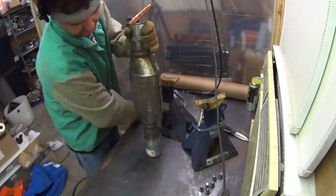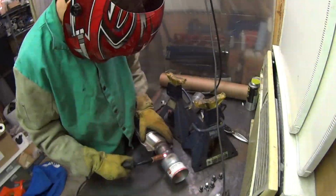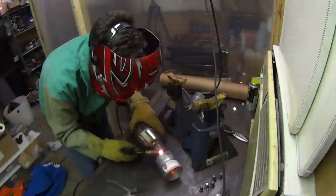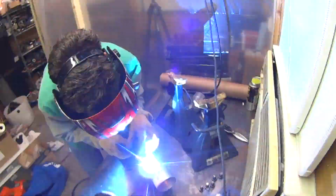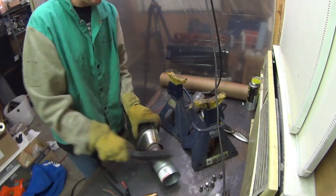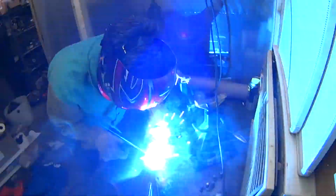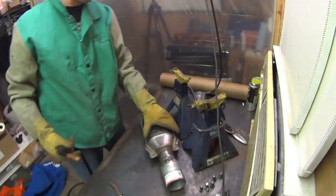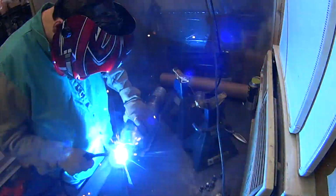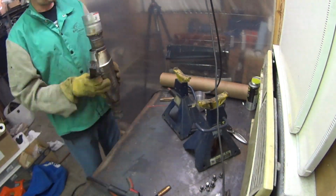I don't think I've ever guessed the knobs on my welder as correctly as this before. Dag gone it, I shouldn't have said something. I just blew through. There's an air gap on the lip of the second weld where we needed it to line up, so I had to stitch weld it in order to control the heat if I wanted the same penetration. Fine by me. That's what they make grinders for. The GSX's downpipe had no provisions for a catalytic converter, so welding a 3 inch ID coupler on one end with the help of that exhaust tip to the converter fixed all of our little fitment issues. It simply didn't make sense to clamp anything together underneath the car because I have a MIG welder.